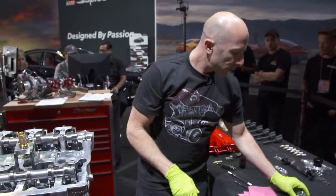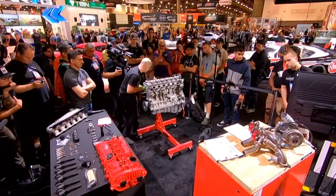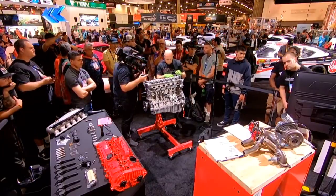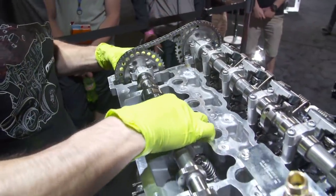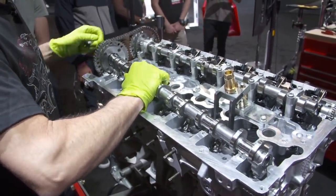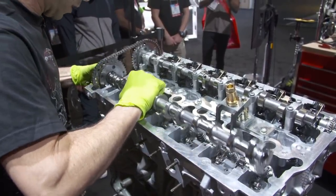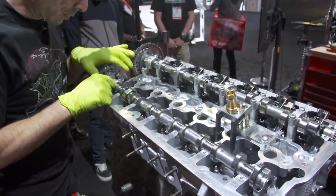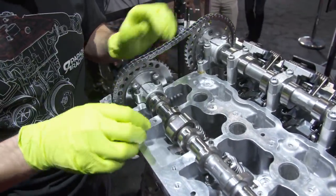Okay. So before I pulled apart the engine, I'm gonna squeeze around you here, I put little scribe marks. So I've got a little cheater mark on the alignment of the cam. So I can get it mostly lined up with my scribe marks on the cam. I scribed the top of the cam and then a matching mark on the cam cap. So that should be lined up.